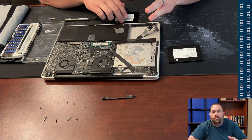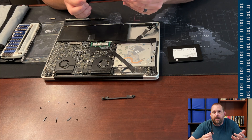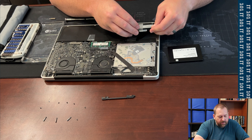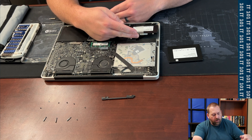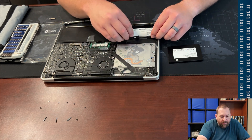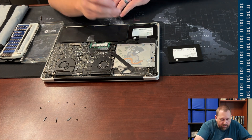I have got all four of the screws into the solid state drive. You don't have to put this little piece of plastic back on there — if it keeps falling off you can tape it on or just leave it off, it doesn't matter. Now you are going to connect the SATA cable to the new solid state drive and then slide it in, putting the bottom part in first — which is closest to the bottom of the computer. Slide that in and let the other part fall, then take this bracket and put it right back here and screw it down. We have to swap back from the T7 over to the PH00 to do that.